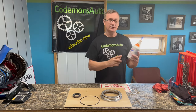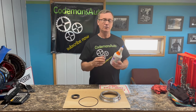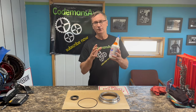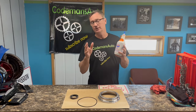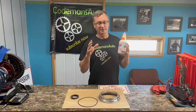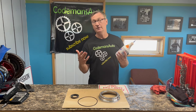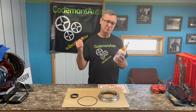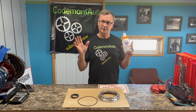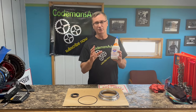Number one: it can stop slips. How does it do it? It has a seal softening agent in it. What it does is soften those old seals that are in the drums and in the clutch packs. When those old seals get hard, they will not hold pressure. So if your vehicle is cold, you start it up, and you pull it into gear and get a slow engagement — this could take care of that problem if you have a seal that has hardened up.